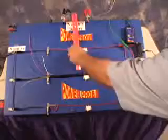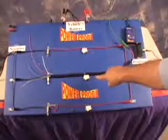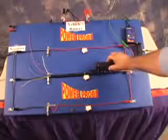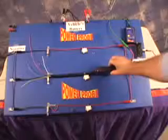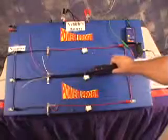In our circuit, we're injecting the open circuit signal exclusively into the wire that's leading to the open switch. The parallel floating wires are all capacitive coupling and transmitting open circuit signals along them. As we trace them, we pass right over the open switch. Let's do something different now.